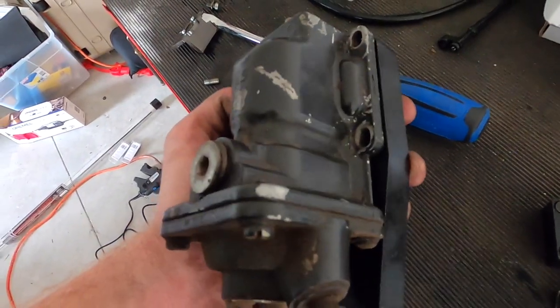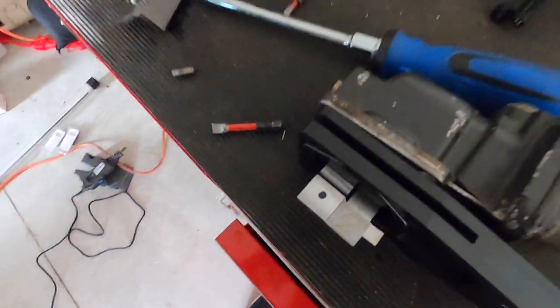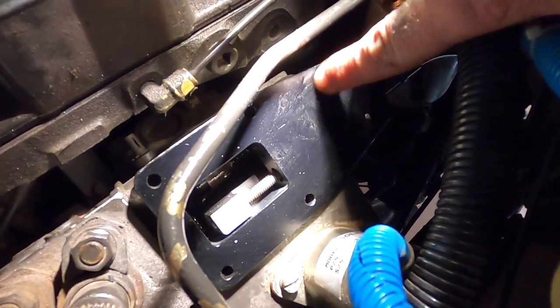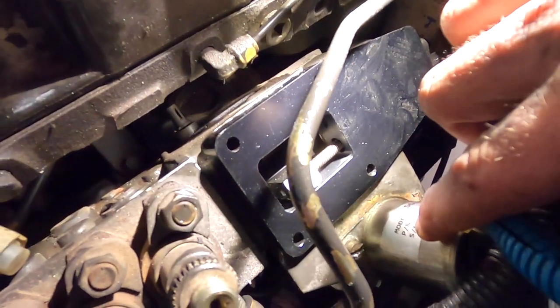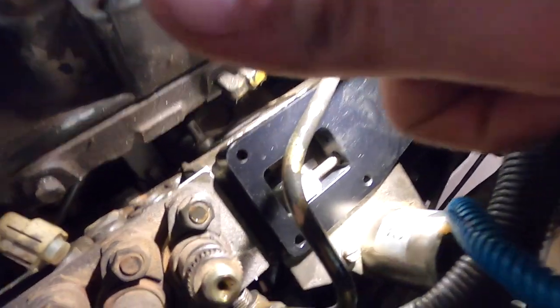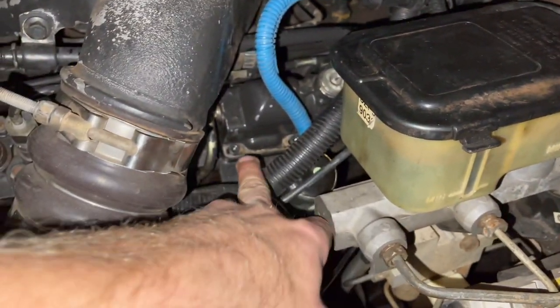Inside the truck that's the cord that goes into the cab so it can adjust this fuel plate back and forth. Once the adjuster is in place, make sure you hook up the cord going into the cab first before you place the plate. I put it all together and realized it was going to be really hard to get to, so I had to take it all back off. Make sure the fuel shut-off solenoid is slid into the groove on the adjuster, then put your AFC housing on top of that and hook everything back up.